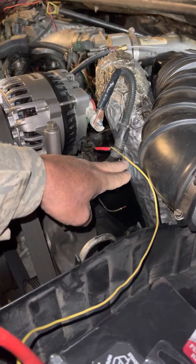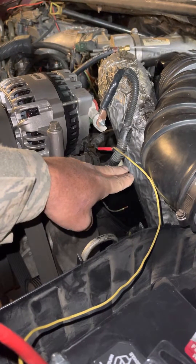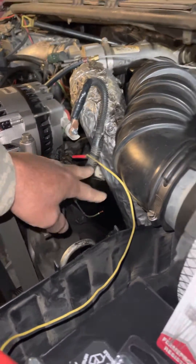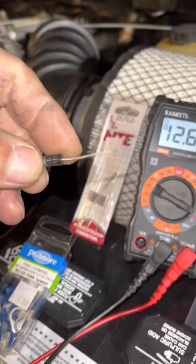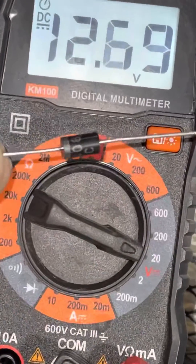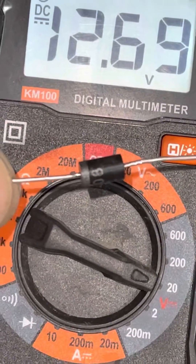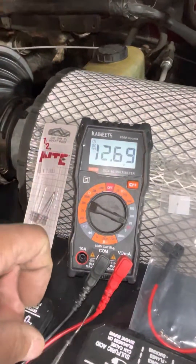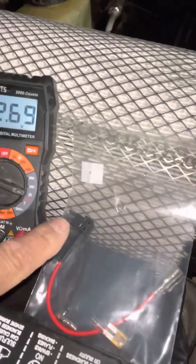I can't find where the power is coming out of my fuse box — all the fuses are good — so somewhere there's a short in this wire along the way in the harness. I'm going to bypass it. This is where this next information comes in. This thing is called a diode, and if you look on the body of it, it has a white ring on it and it's directional — that white ring goes to the alternator. The electricity comes through the diode and it won't let it go back. This runs on a 5-amp fuse, and the next thing is a pigtail connector.